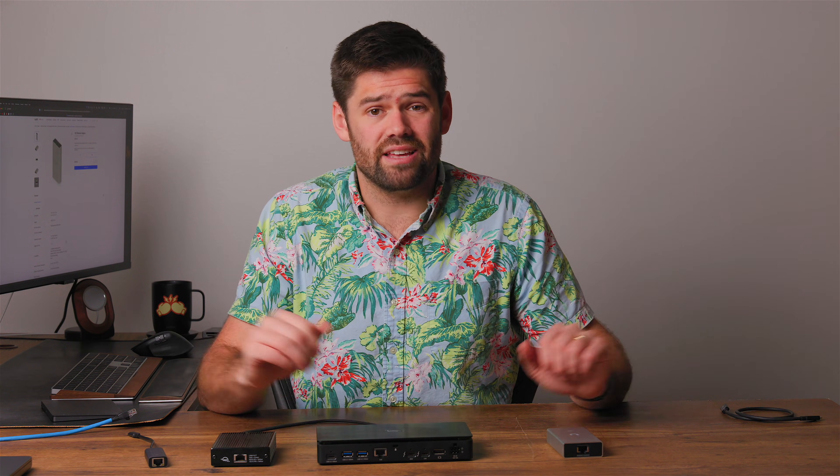All of these adapters — and pretty much all adapters you're going to run into — are going to be able to saturate the advertised networking speed. When I do an iPerf test with these I get within five percent of the actual advertised speed, which when you include overhead is pretty much exactly what you'd expect. So the 2.5 gigabit adapter gets 2.5 gigabit networking, and the rest get around 9.9 gigabit — really great, no issues there.